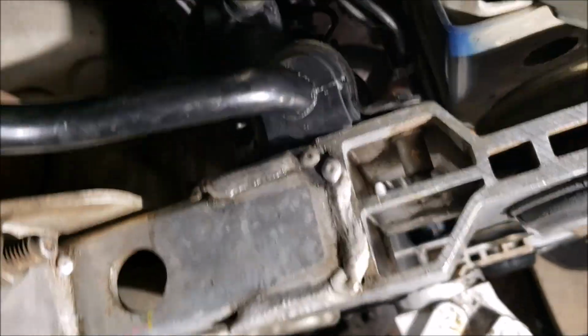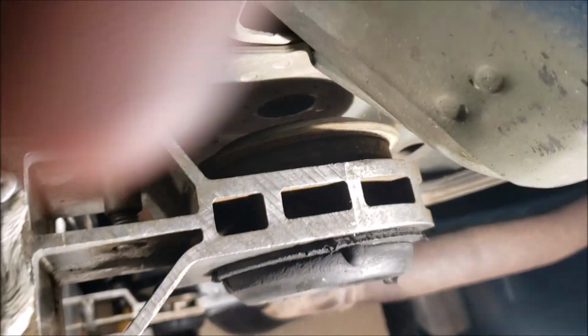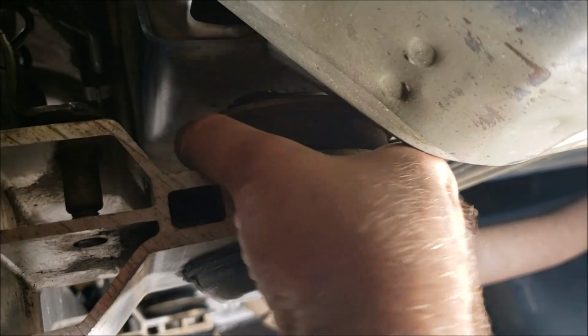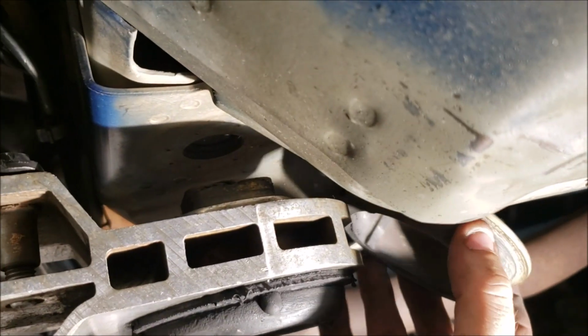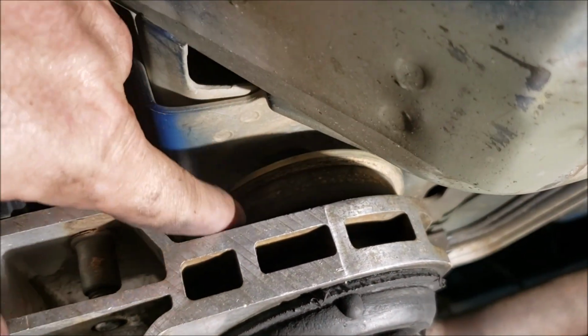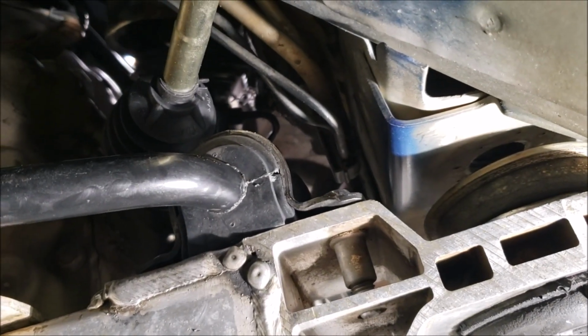Now what I will add, I got lucky and I was able to take my top cup on my K member. Oh, I should have a tripod with me. Okay, put this in first. Well, it went in pretty easy. There you go. Just in case, because it's cutting it close. Fortunately, that's rubber, and it'll push in. But I would say put both of those in on each side first. And then just crank it up till you're 1 3/4 inches away. And then you should be good to go.